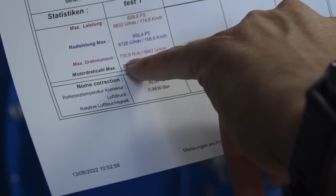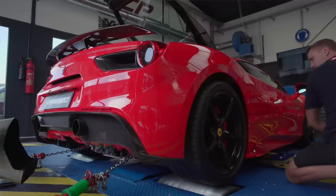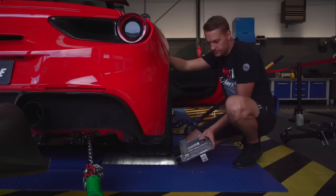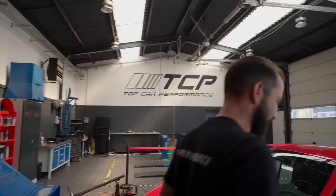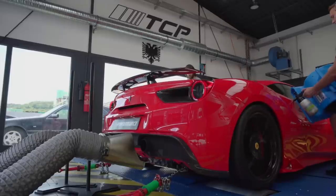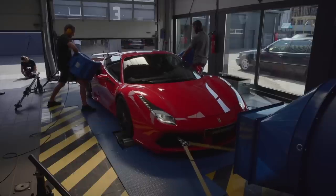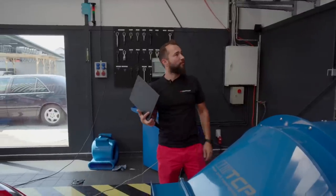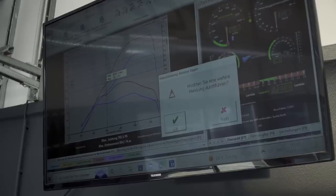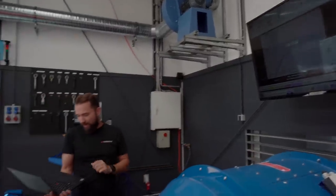Zbichek is now lifting the car on the jack. We removed the wheel arch liner to access the ECU. Here you can see the result again — 628.9 PS and 730 Newtonmeter torque. Somewhat less than advertised, but as I said, it's hot. Some tolerance is fine. Stage 2 with 200-cell racing cats — first test result: 795.5 PS and 934.1 Newtonmeter. I can see a maximum boost pressure of 1.5 bar, which holds cleanly almost to redline. At redline we still have 1.4 bar.